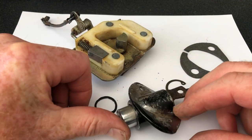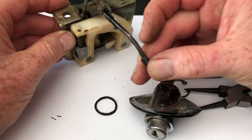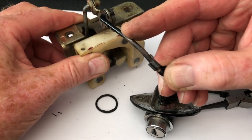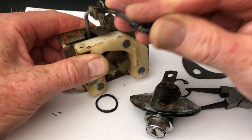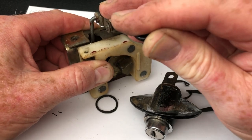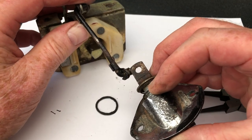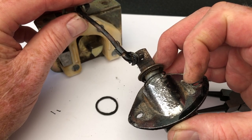Inside, that obviously pushes this tab here, and if you imagine that's in situ in the back of the boot, it's attached to the lid facing you at the back. Here's the mechanism - when that key turns and you push your button here, it push-rods onto that, which as you can see is moving that block near my left thumb, which then releases it against the catch at the very back of the boot. There's a simple fulcrum system just to release it, operated by this, which is attached to this bit here. It's a right fiddle both to get off and to get back on.